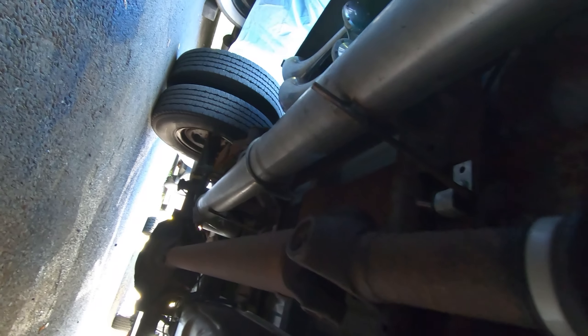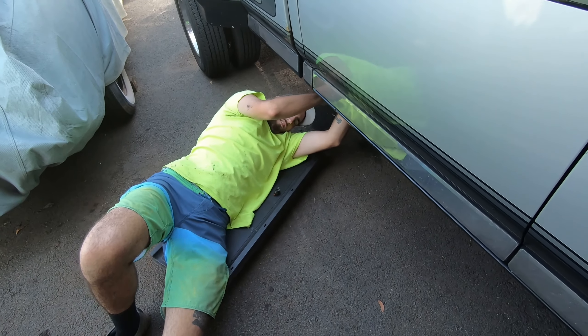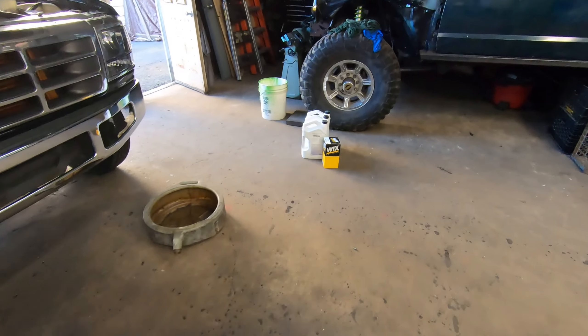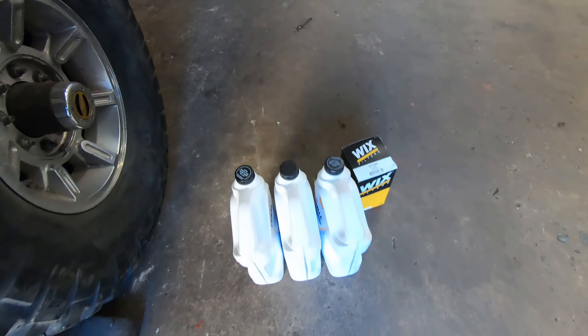This big old monster driveshaft is ready to be fully torqued. I've got my brother changing the pressure switch on my air horn setup, and we're going to change the oil on this thing. It's only been a thousand to eleven hundred miles since I changed the oil last, but since it's a new engine I want to stay on top of it — first change after a hundred miles, now after a thousand. I'll probably let it ride out to the three-to-five thousand range that a regular IDI runs. You know what we got — only the best.